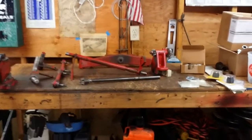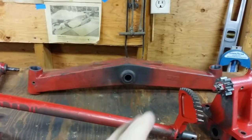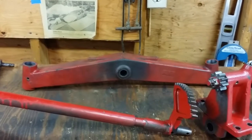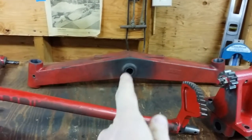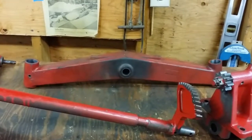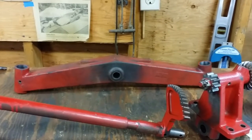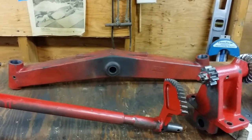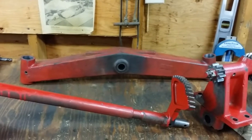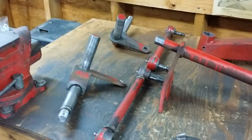The one thing I am not going to use from the 520 is the forward-swept axle — basically the cast iron axle that was on the 520. This is a standard mid-60s cast iron straight-style front axle. The forward-swept axle of the 520 came forward and was wider from spindle to spindle than a standard 60s tractor. On my short-frame tractor, I think that would look really hokey, so I'm going to modify this standard front axle to accept the larger, heavier-duty 520 front spindles.